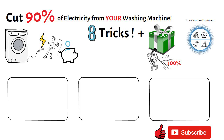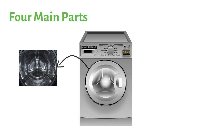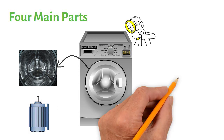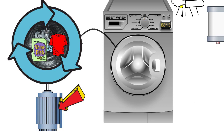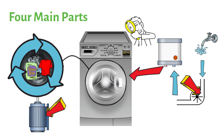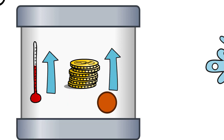There are many different parts inside a washing machine, but only four of them tell you everything about how it runs and how you can reduce your energy bill. There is the visible part, the so-called drum, which carries your laundry. There are also hidden parts running the machine in the background: the motor, pump, and heater. The motor drives the rotation of the drum, the pump pushes water through the heater and into the drum, and the heater increases water temperature to the level required for your chosen washing program — it is the part that consumes most energy.